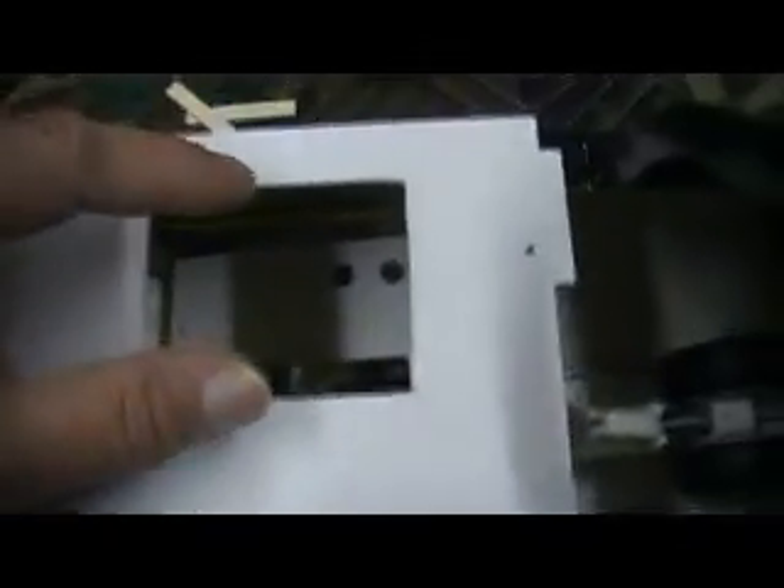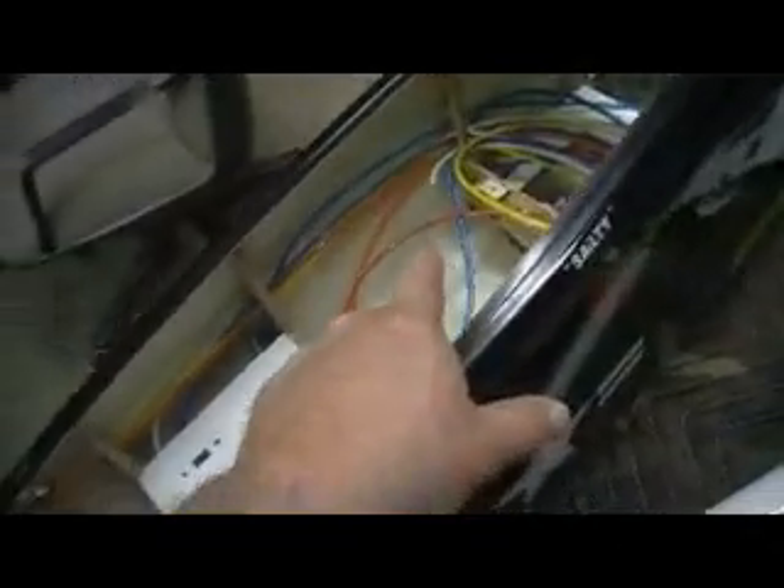I'm going to build me a little shelf in there so I just got the top of my box sticking out. Now there's another place for air tanks right here. They're supposed to fit in there, but I have two of these other tanks and I want to use this space for something else. So I'm just going to build me a shelf across here. I'm going to mount my UV5 Pro box right there on this side. I'm going to have a whole mess of Jettronic electronic valves — the dual-action valves, kind of like retract valves — to work the canopy, to work the lock on the canopy, to work the speed brake, and to make mode three on my landing gear doors. So I'm going to have four of them. I'm going to build me another little shelf way down here and mount all four of the Jettronic dual-action valves on that board.